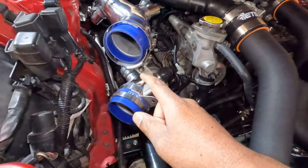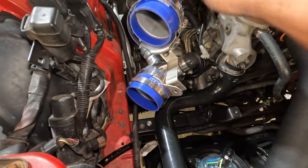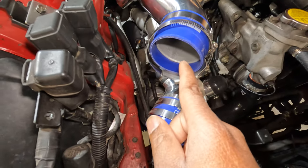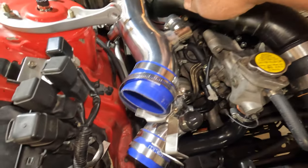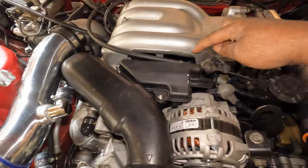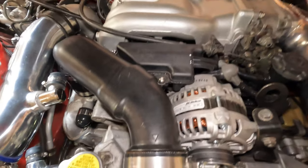So the game plan is: I'm going to plug the primary intake runner, and then on the secondary turbine runner I'm actually going to run the smoke through. Theoretically, smoke will run through both turbos, then through the intercooler piping, up through the intake manifold, and hopefully hit all the vacuum lines. If we don't get any smoke, we'll be good.